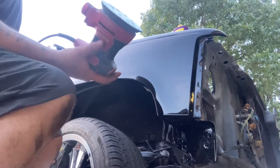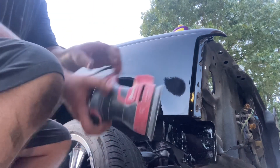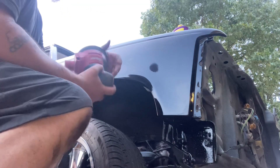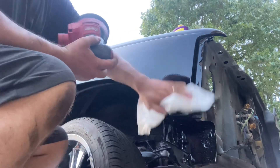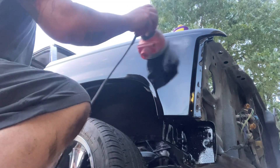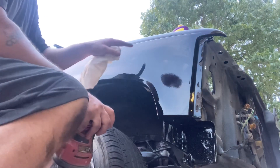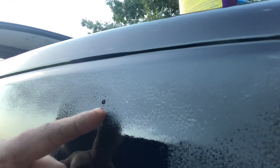I've got a fresh sheet of 1500 on my little orbital sander. I run it on number three — not super fast, just take it slow and easy — with just a barely moist paper towel. We just start sanding on a brand new paint job, which seems totally insane. But already you can see there's a piece of trash in the paint, and all these little black spots — orange peel — that we're going to sand out.